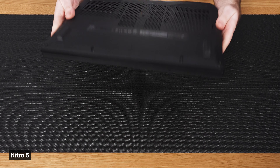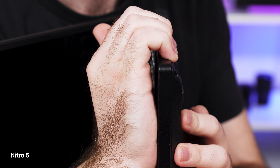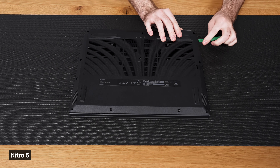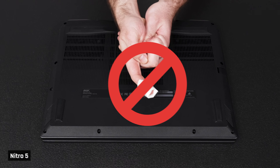Now that you've backed up, ensure the laptop is turned off, flip the laptop over, placing it on a surface that won't scratch your lid. Carefully undo each screw so that they don't strip. Open the laptop slightly to place your palm on the palm rest, then gently push so that the back of the laptop starts to come off. Place a plastic spudging tool in the gap and wedge the back off the laptop. Do not use a metal tool as it can scratch your device, and don't use your fingernails — a lot of pain can come from that.